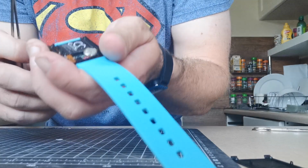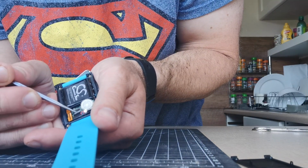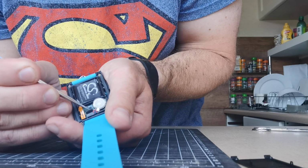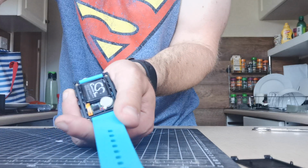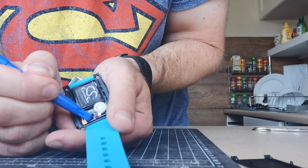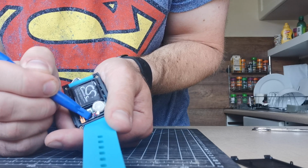One last thing. If you see here, there's a bit of tape over something. That's a plug, and sometimes that plug comes out, so you have to push it back in. Actually, best to do it with a plastic implement. So you just push. It's next to the motor. It's the thing that you need pushed in when you get the screen tearing problem. Sometimes it pops out.